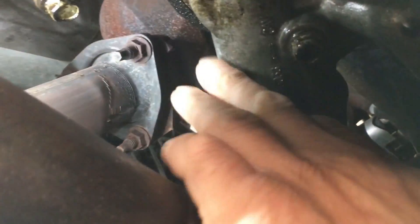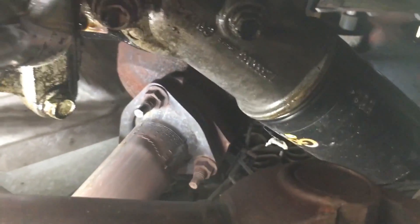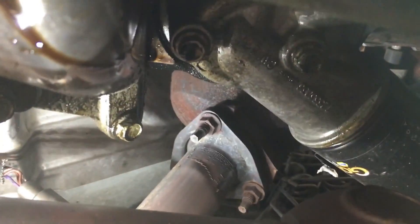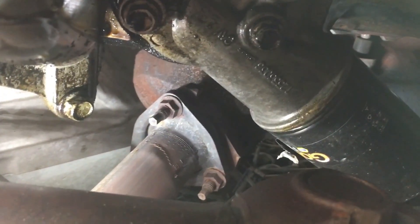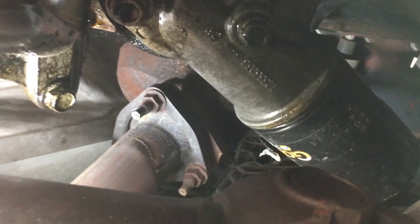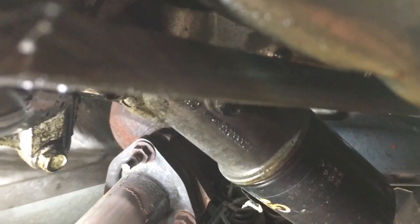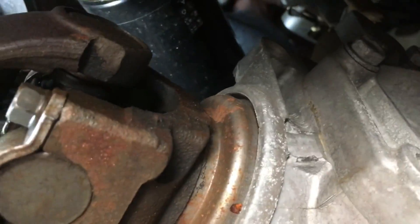Here's the front differential, and the front driveline is immediately above. This is the adapter we're going to change out. The lighting isn't great, but there's oil running off of here causing problems. When you do this, the new oil filter is going to point straight down like a Chevy 350 normally would, but you have to run a short filter to clear the driveline. This driveline is fixed within the chassis. If you have a lift kit, you've got a little more room, and a short filter may not be required — a lot of lift kits lower the differential attachment points and give you extra clearance.